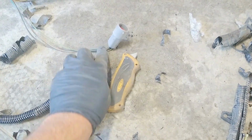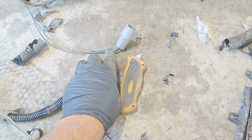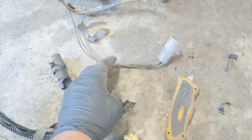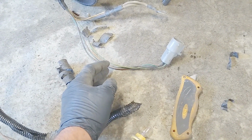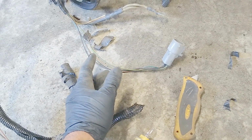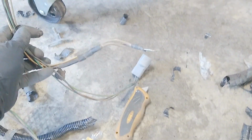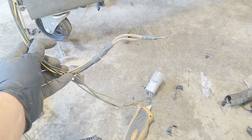There's two wires here that go to the air conditioning stuff, and then there's your idiot light wire on the dash for the alternator. Basically, when you key up, you turn on the alternator, and that allows it to charge the battery. If you don't have that wire hooked up, the alternator will never power up and start charging when you start the vehicle. So you need to keep that wire. If you're pulling this out of the junkyard, you could just unplug, unbolt, and pull this off, and now you've got what you need for the alternator.